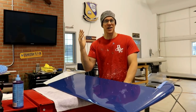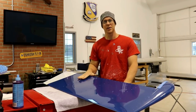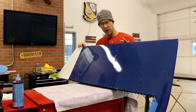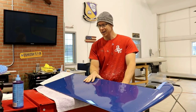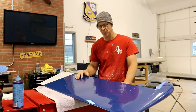The orange peel on the rudder doesn't actually look that bad — a professional painter I showed it to thought it looked pretty good. Maybe my standards are just too high and I want that show car finish. I've already done one side and it came out really nice, but I didn't eliminate the orange peel 100%. The reason is I only have two thin coats of blue paint on here and I'm afraid to sand too much and burn through — if that happens I'd have to paint it again.